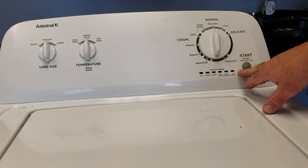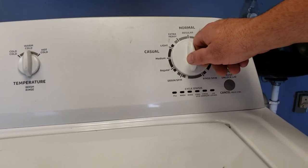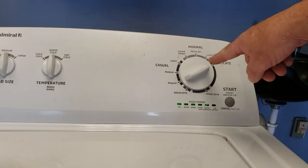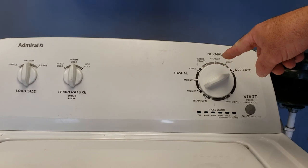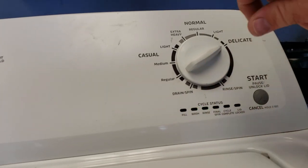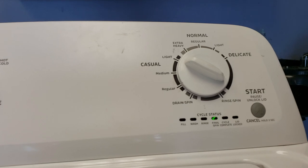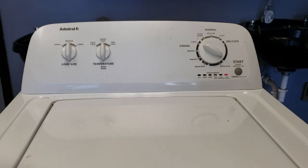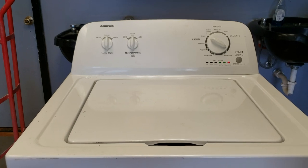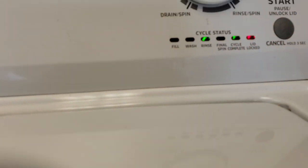Once you're done, it's always best to go back and do a diagnostic mode. This is for any of these models that have the lights at the bottom of the timer on the control board. What you're going to do is go around twice, stop at 12 o'clock, go left once, right three times, left once, right once. You'll know you have it right when you see all the lights blink. If you take too long or go too fast, it won't accept it — go at a normal one-second pace. Once you get to that point, go down one, two, and it says be on final spin. Then hit start. This mode goes through all the wash cycles — it fills up with hot, cold, and warm, then agitates, drains, and spins. Once it's done, it'll say cycle complete or done, which is what we're looking for.